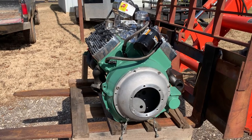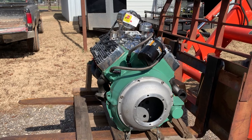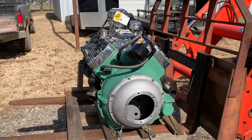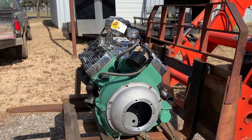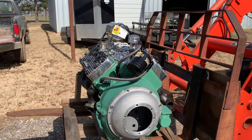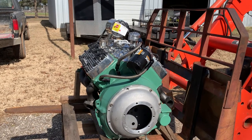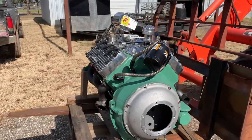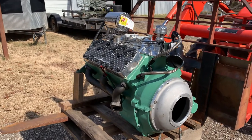So what's this mating to for a transmission? It's actually going to have a little Ford C4 in it. Which was funny — a lot of the traditional guys get pretty far ahead of themselves. The really funny part is it has the '39 top loader that actually came in that Mercury, which for traditional hot rod builders would be the most desirable transmission. But Jake goes, 'Hey, it's my wife's car, and I want her to be comfortable in the car more so than grinding gears in a transmission that shifts like 1939.' So she's going to run it down the highway. And that's what brought me to thinking about the fuel injection — cold startups, hot startups in town, stop and go. He said, 'That's exactly what I want.' So this is engineered and designed to make it an easy driver in town and then perform out on the highway, and still look traditional.